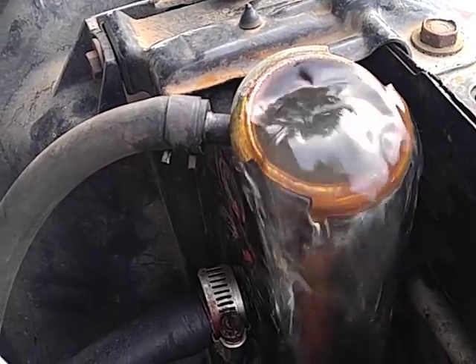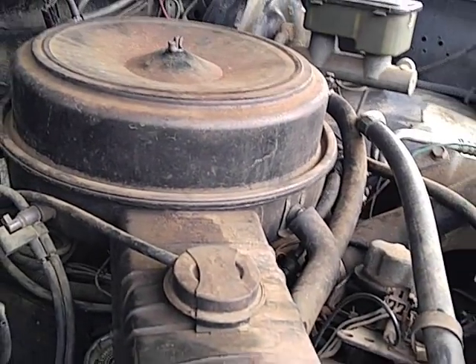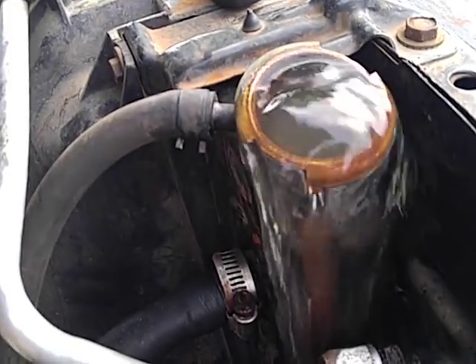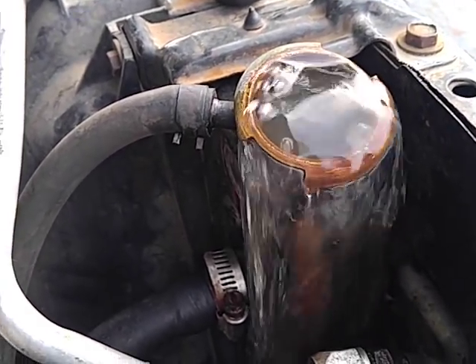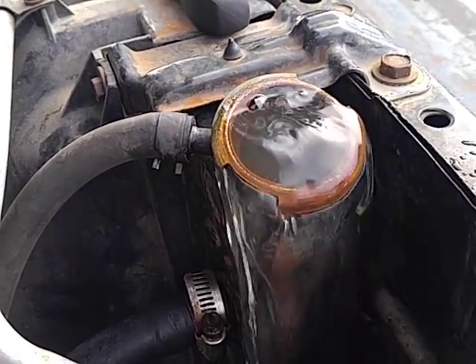It's got heavy-duty air cleaner, air conditioning, power windows, power locks, power tailgate, and an automatic overdrive transmission which was rebuilt. Maybe I'll take off the air cleaner and adjust the throttle valve cable to make it think I'm giving more throttle — because at light throttle it shifts adequately, but at medium or heavy throttle it's got a lurch-bump shift, which I suspect means it's not getting enough pressure. That's how you alter the pressure with the throttle valve cable.